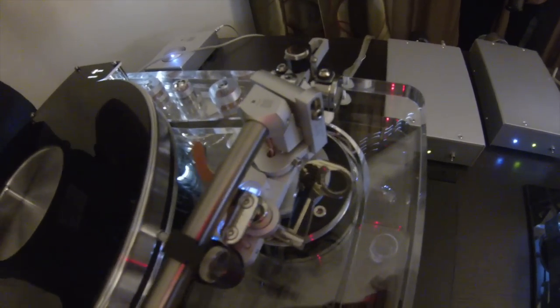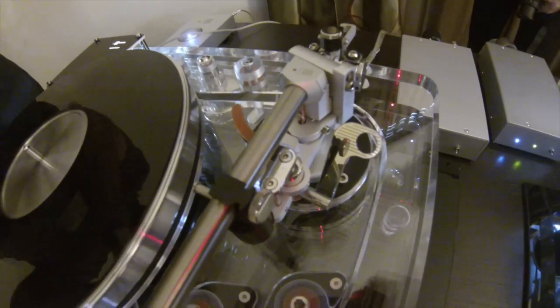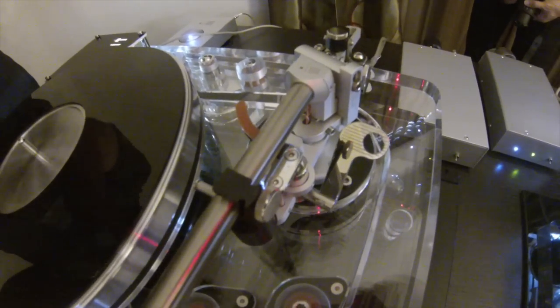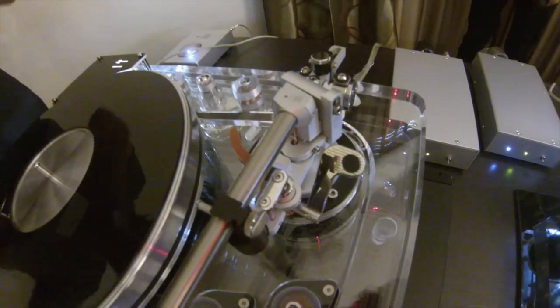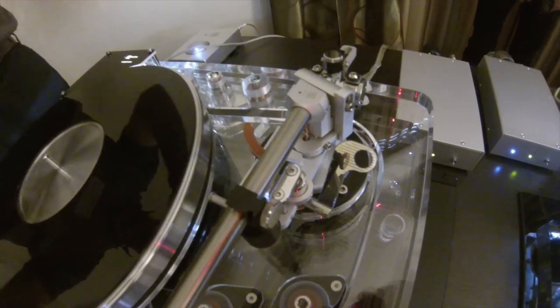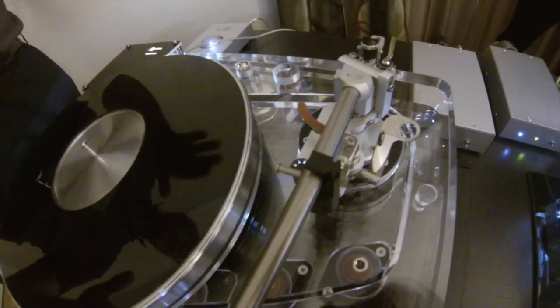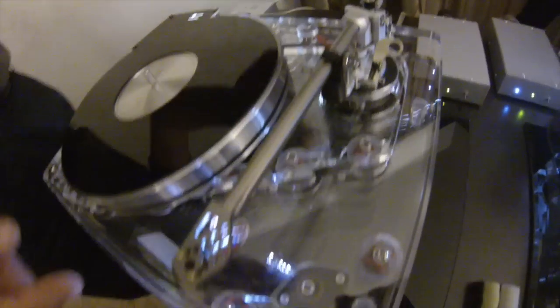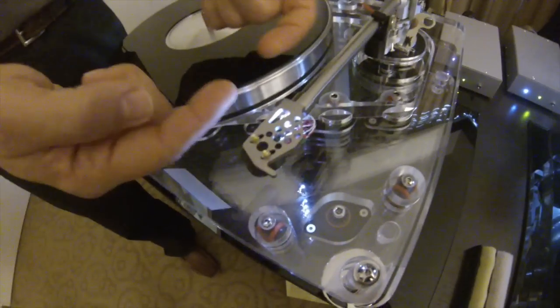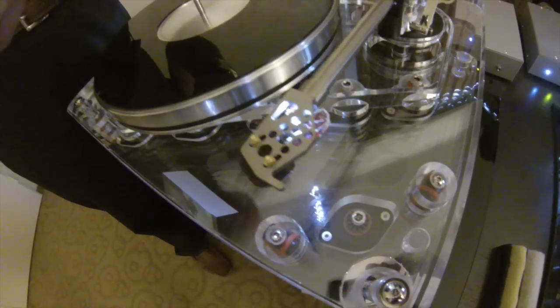So you're tailoring your tracking weight so that as the record leaves the cantilever suddenly, the tracking force is increased. So you minimize the deviation from where you should have been, and you hardly hear the warp problems. When it comes to the arm tube and the head shell, they're machined from titanium, the 2 pieces. But titanium has a property of self-fusion.